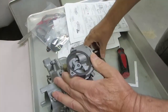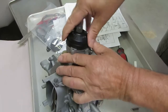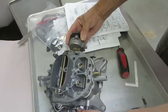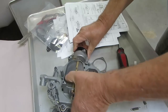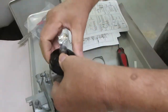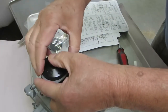So you see that little lever in there with the split in it — that's what you put the end of the choke coil into. It turns counterclockwise in this case. What you want to do is open the throttle and twist the thermostat so that the choke just closes, and then another eighth of an inch, and that should do it. You want to be able to use a little bit of pressure to open the choke valve.